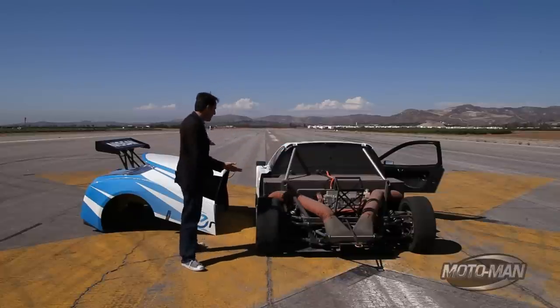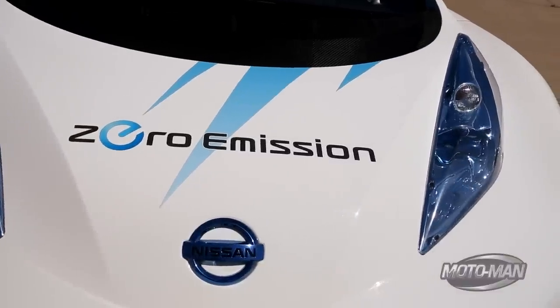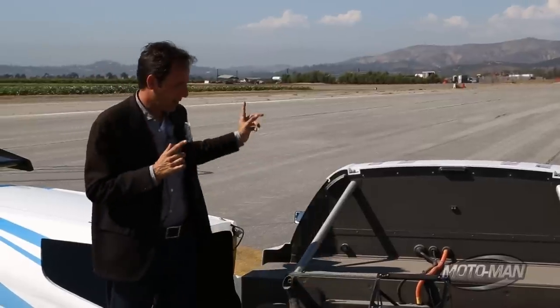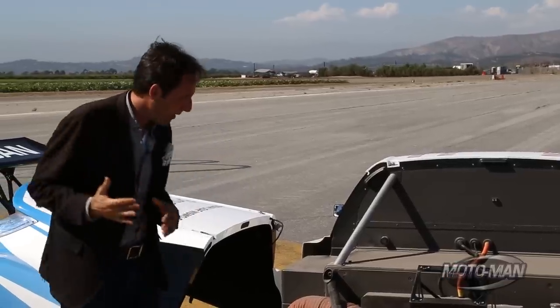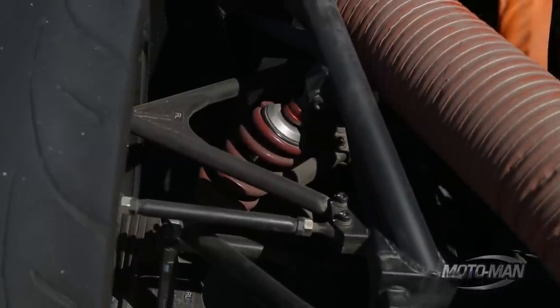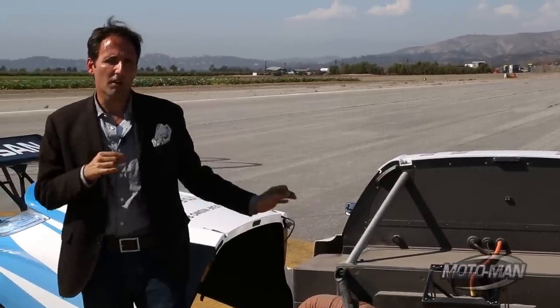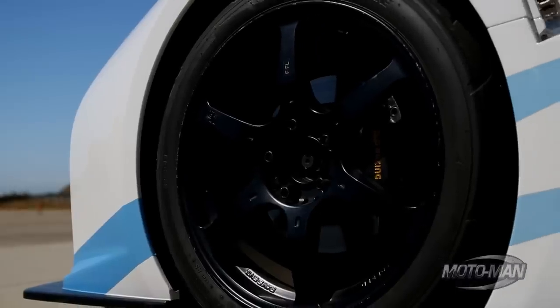Just look at it — it's made virtually all of carbon fiber. The roof, the hood, the doors, and especially the tub is all carbon fiber. Connected to the front and the rear is an aluminum subframe. Connected to the subframe, we have a typical race car wishbone suspension with coilovers. There's a little bit of GTR thrown in here too — the wheels are made by Rays Engineering, just like your standard GTR.